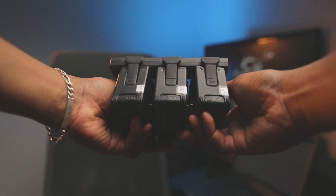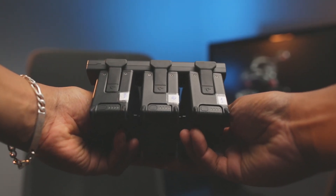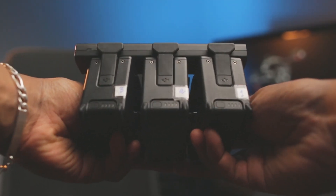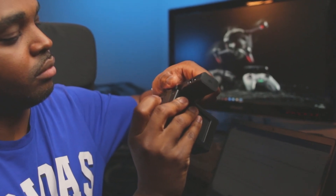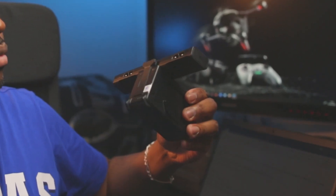Those DJI FPV Smart Batteries are three to five times more expensive than traditional LiPo batteries. How should you charge them? Give them at least 30 minutes of rest between two charging cycles, for the voltages to recover on the cells and for the cell temperature to go down. Keep them connected to your charging hub only when they are being charged — when charging is done, just remove them from the hub.